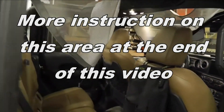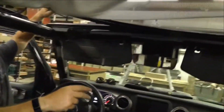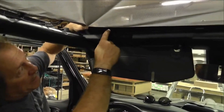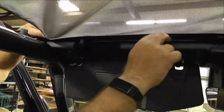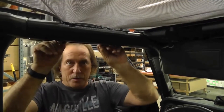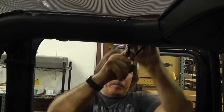You can probably look through the passenger door. Now I've gone around to the front. We have the back bungee in, so there's a little bit of tension on it, but this thing will slide right up in here. This thing should be perfectly flat. This is just a little tight — we want it tight. Take your bolt, stick it through like that and it pushes right in. We want this really tight so that it's pulled tight from here to there. Then grab this bungee, hook it on both hooks, come around, grab it here, hook it, hook it, grab these, hook them. You're only going over the roll bar, not the outside of the frame.